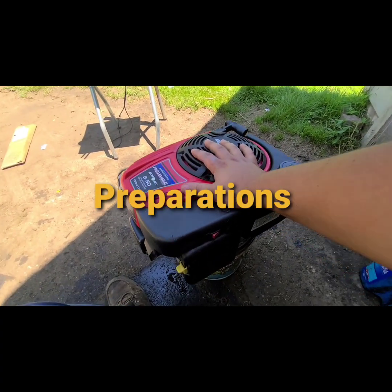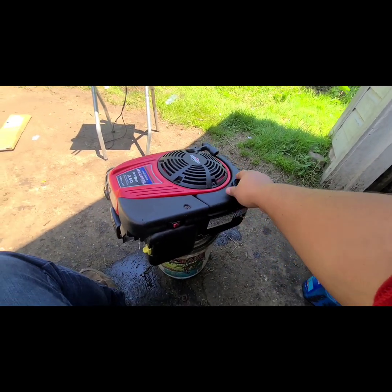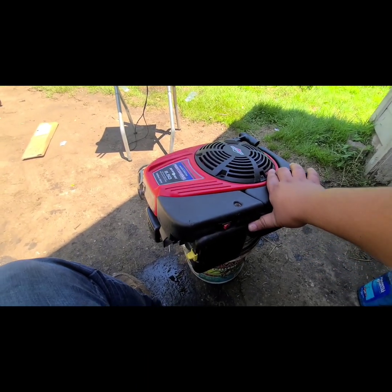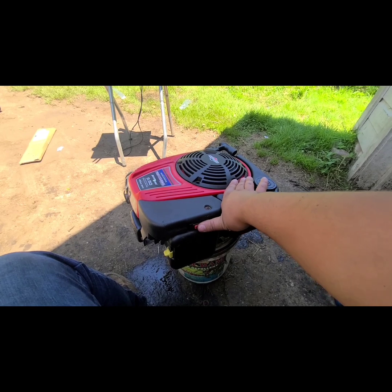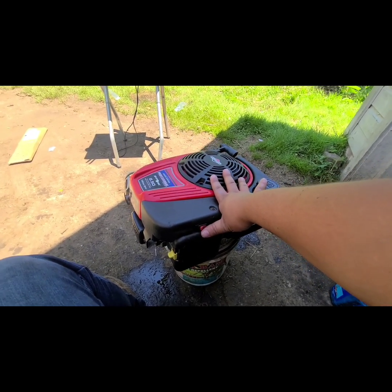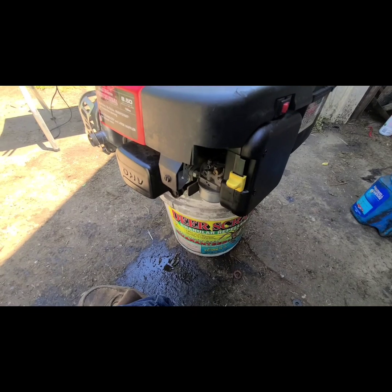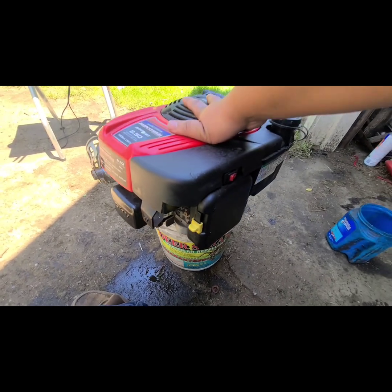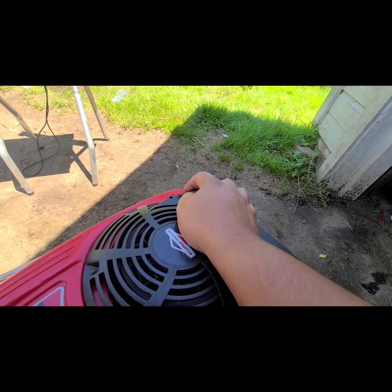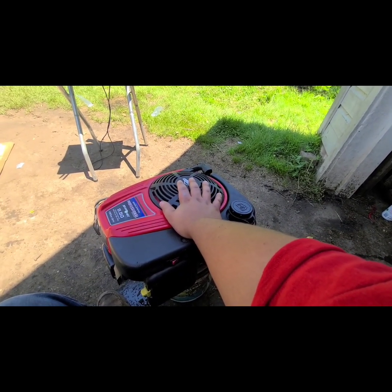Now the preparation stage for this build: I pulled this engine off the shelf. I don't remember exactly because I was given this engine recently, so I don't know how long it sat with gas in it. Even though it ran when I fired it earlier this week, I still drained the carb, sprayed the gas tank out with some carb spray. I also decided to clean the carb and determined that the bowl nut seal needed to be replaced, but I had one here in the shop. We also drained the oil — even though it didn't need changing, we are going to change it, so I've already drained it.